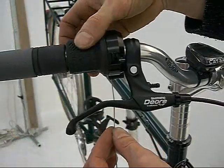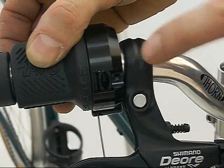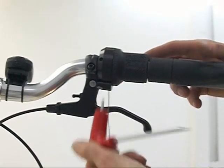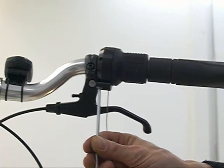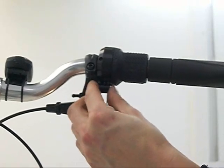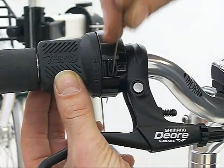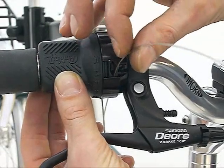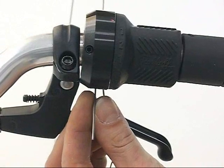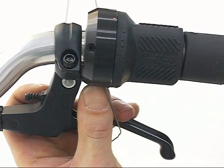To replace the top cable, line up the cable nipple seat on the right hand side when looking at the front of the shifter. Remove the lower cable stop using the Torx TX20 driver. Insert the cable into the cable nipple seat until the cable exits the shifter as shown. Pushing from the top, feed the cable back into the shifter cable run and around the inside of the shifter.